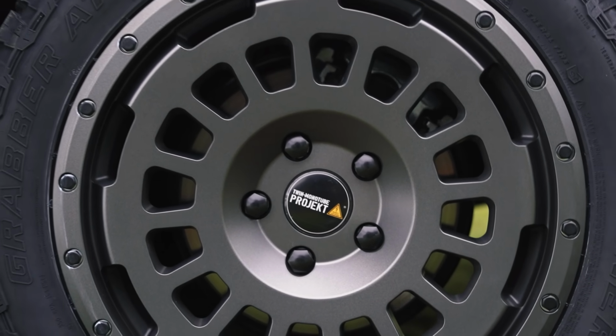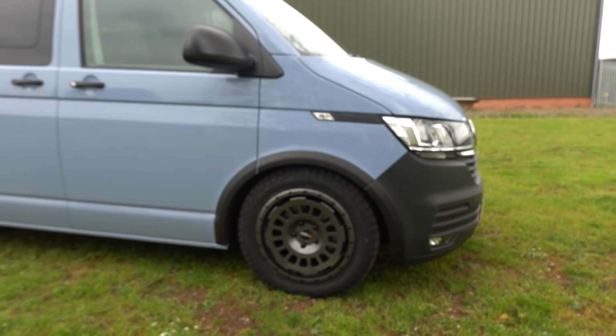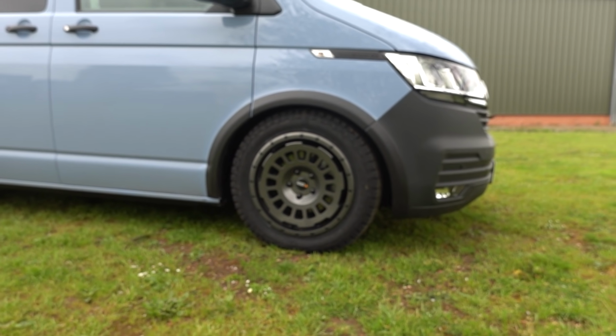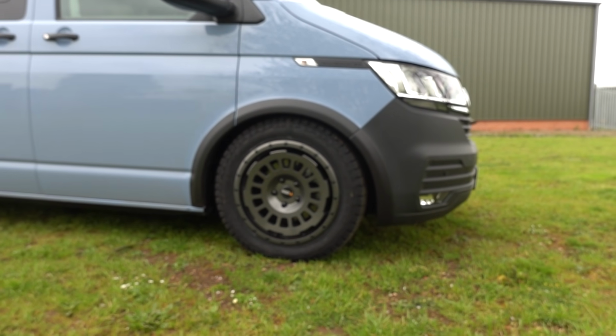This tyre just lifts it that little bit higher back off the ground again to give us the clearance that we wanted. So this is about 13 mil. This tyre profile makes the wheel about 13 mil higher lifted than it would do off a standard tyre, and also you lose 13 mil of the arch gap by going for this tyre.